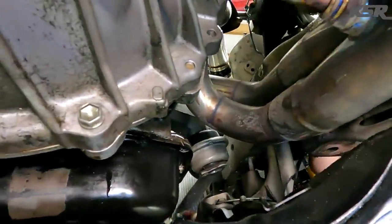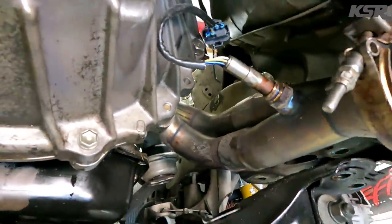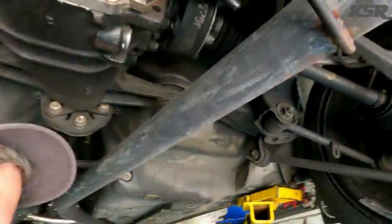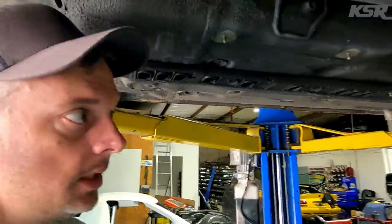It's got a little trick exhaust here with a merge collector. A little bit extra trickery there. Actually, a 2¾-inch exhaust pipe is what the math said is all it needed. A little bit lighter than the exhaust that's on my car, which is a stainless 3-inch that came with the car. And then we chopped it up and made it better, I think.